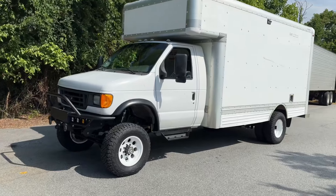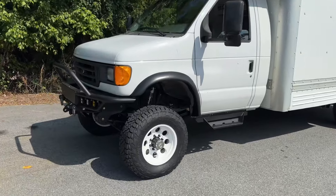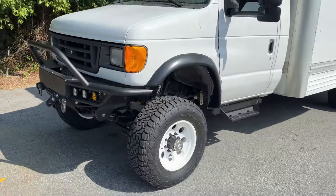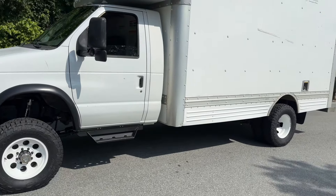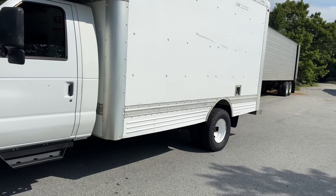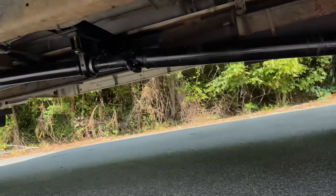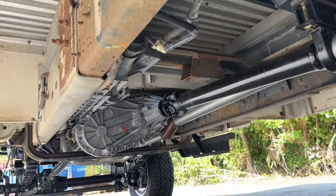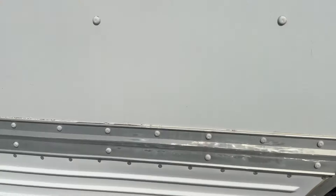Here we are — complete. Since the last clip we did the brakes, track bar, alignment, finished all the wiring on the bumper, got the S-pod in. Everything is looking good. Got the flares installed, side steps. The wheelbase was a little too long to run a one-piece drive shaft, so we actually wound up fabricating a carrier drop crossmember so we can run a two-piece drive shaft. We made that crossmember, got the two-piece drive shaft in, got the exhaust finished. This thing is basically road-worthy — just got it back from the detail shop this morning.